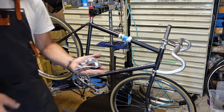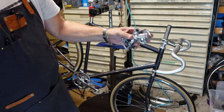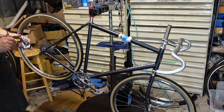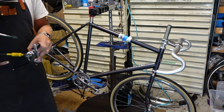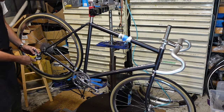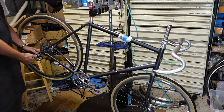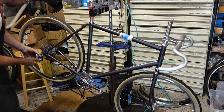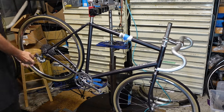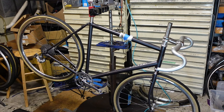Pretty amazing. And here's a medium cage, which is kind of a long cage with a big pulley wheel. Dura-Ace 7700 9-speed derailleur that I'm getting to work with this 11-speed cassette, but it's friction bar end shifting. And I'm told, my sources say, it should work. But the max tooth capacity of this derailleur is what's requiring the Road Link here. And the Road Link just extends the hanger. So that looks like it should work theoretically.